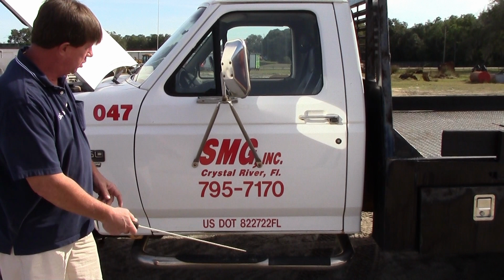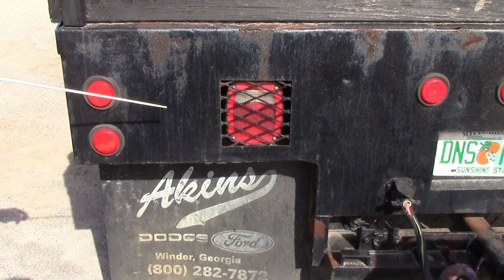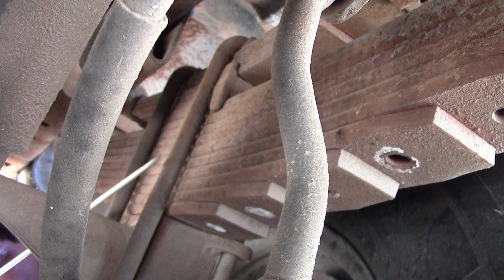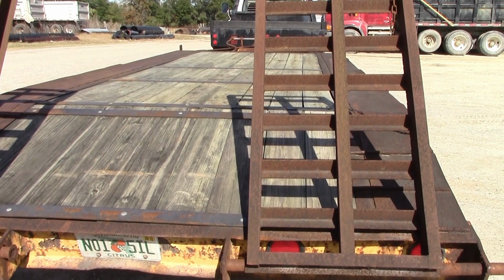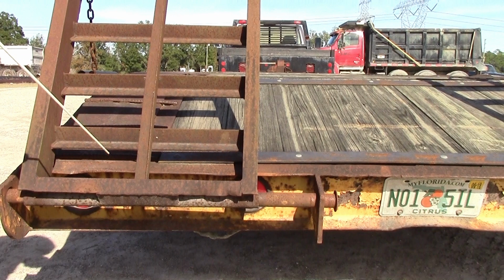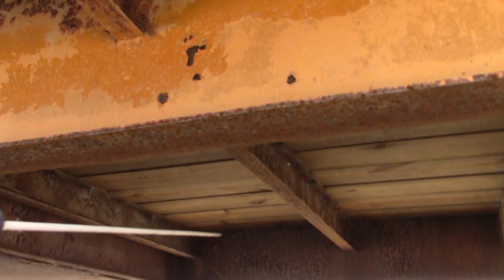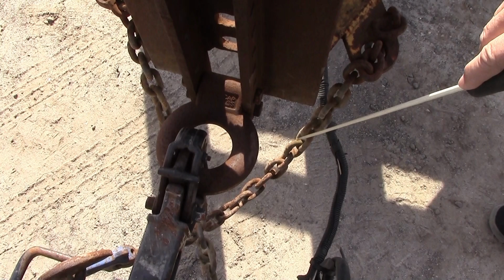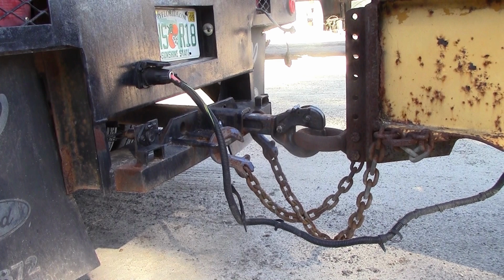Then we'll do Form B, which will be from the driver door to the rear of the vehicle. These items will include the underside of the vehicle and our one rear driver's side axle. Then we'll do Form C, which is going to be our trailer. We have to inspect one axle of a trailer, and we do have to inspect the rear of the trailer and the underside of the trailer. We'll inspect our coupling system, which everybody will have to inspect for the Class A pre-trip inspection.